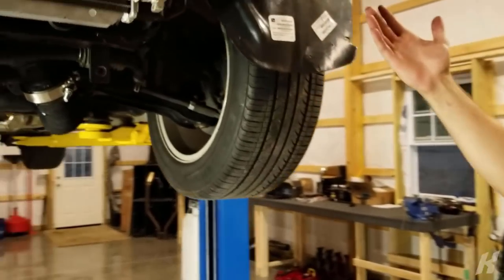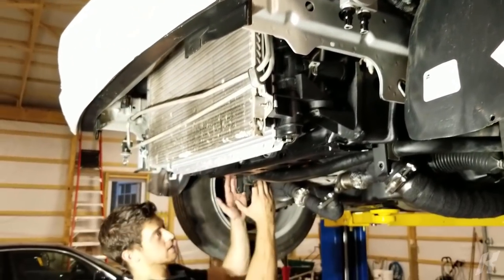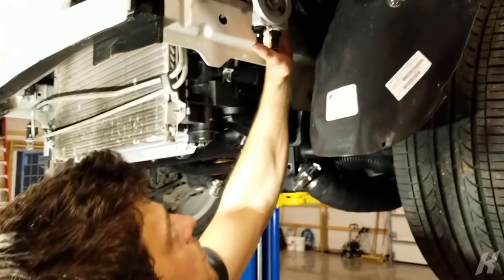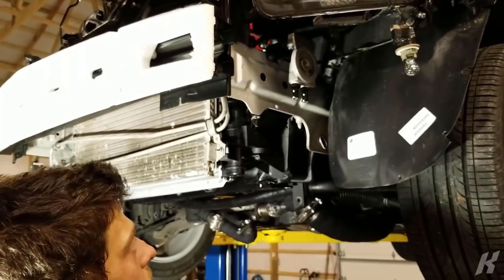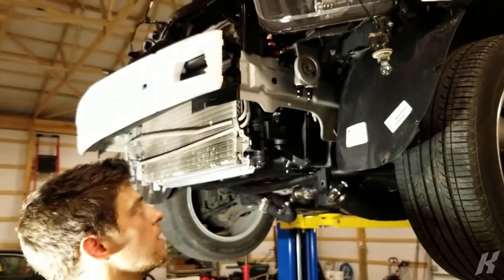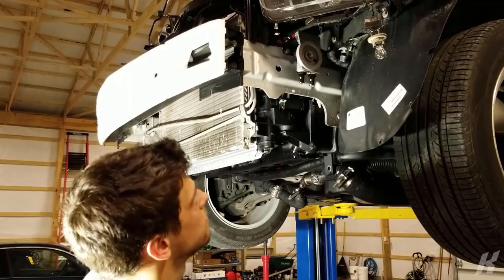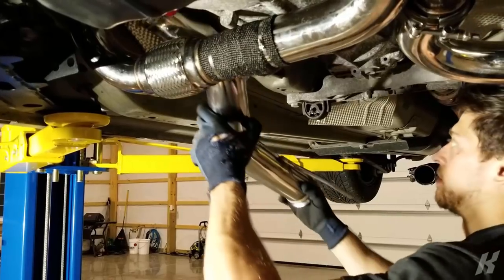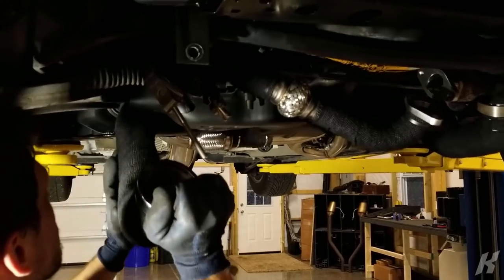Did you see my oil filter relocation bracket? Super custom. Where they show you to mount it is way over here, and then you have to run all the lines against all these hot pipes. So I made this little bracket and test fit it with the bumper, and everything should be good. Intercooler pipes are right here, so the oil should drip past them, not on them. It's a lot shorter to where it needs to go. Definitely hits everything.